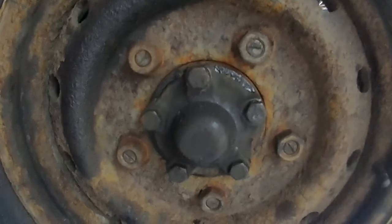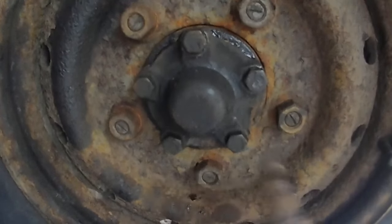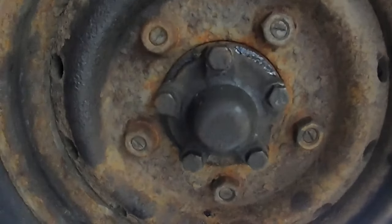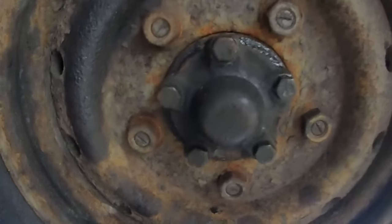The wheel is now back on — not fully torqued down yet, just hand-tight. I've grabbed the tyre at the bottom and top at the same time, given it a waggle, and all the free play that was there has gone. That's that done. On to the prop shaft — well, I've got it all apart and one of the yokes has a crack in it. Good thing I found it now I suppose, but it means I'm going to have to fit another prop shaft. Never rains but it pours around here. Anyway, that's enough for now — see you in the next one, whatever I'm doing then. Take care, bye!